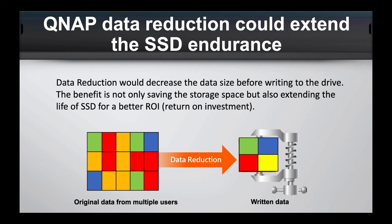This achieves two things: it saves you a lot of capacity so you don't need as much upfront, and the capacity you do have will last longer because you're not doing as many writes per day with the data reduction options. All of the QTS Hero NAS units — you can identify them by the small 'H' in the part code right after the first dash — can have inline compression and inline data deduplication enabled on every share and folder that you create.